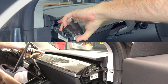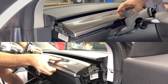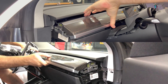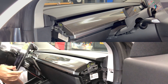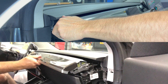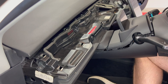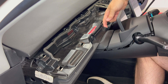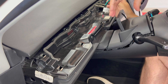Pull up the entire dashboard by the front edge. There are a number of clips holding it into place. Then I need to angle it to remove it from this location. It can be a little tight due to the touch screen being close to it, so just be careful when you remove it. Once it's loose, place it aside. Take the wire harness and stick the end with the two small block connectors through the right side of the fabric shroud — there is an opening where it will fit.